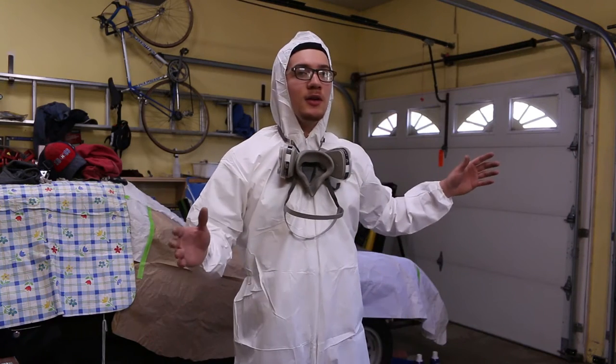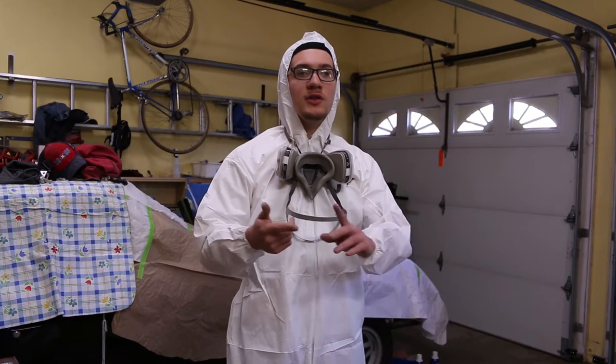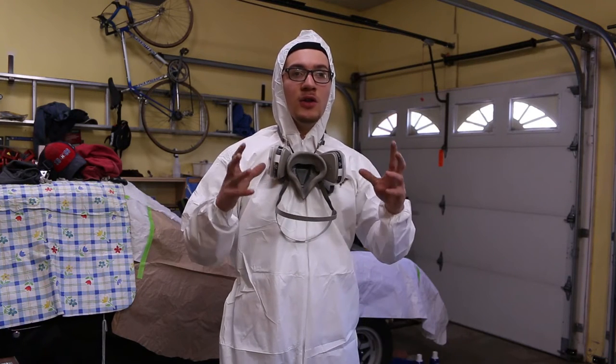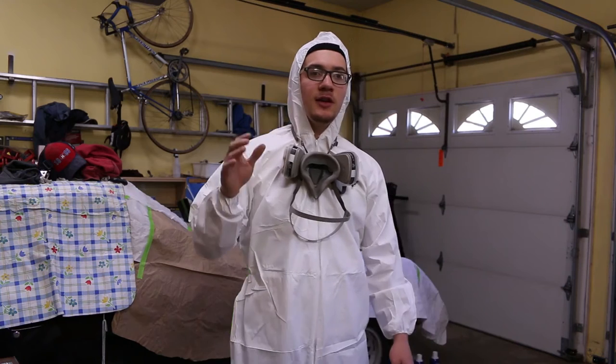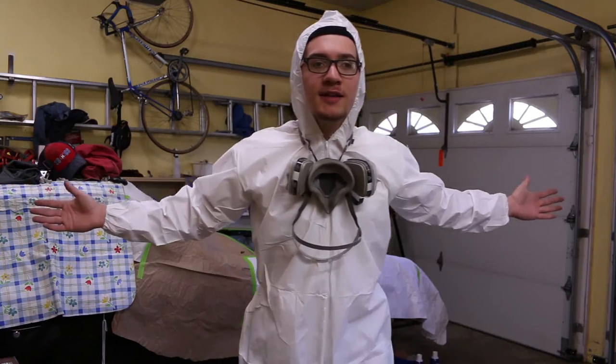It might still travel and get little specks on the back of the car, but most likely it'll be able to be polished off. Before we go into paint, in the last video you saw that I did go and tape everything off. That's step one, but you still have to make sure the surface is going to be clean. I'm going to go through with brake clean first and then rubbing alcohol to make sure all the surfaces are perfectly clean with no grit, because the sand from sandblasting gets everywhere. I've blown out and vacuumed the car a couple times and I'm going to wipe everything off now.